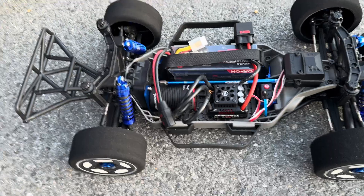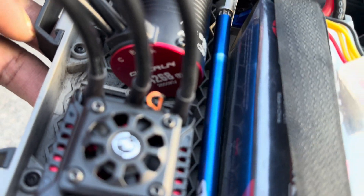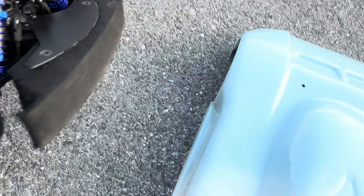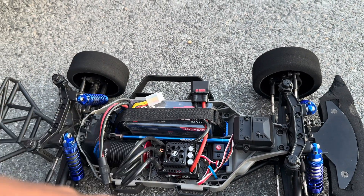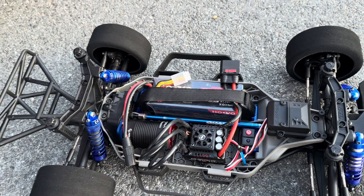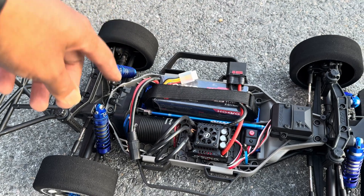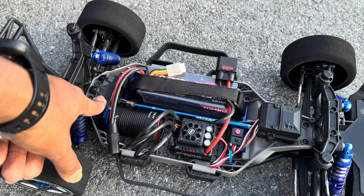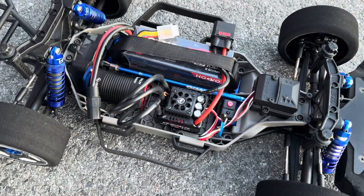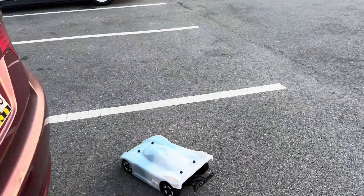All right, so here we have it — another BL150 system. This is a 4S with the 2600kV motor running with this car body, slightly different setup. I'm gonna show how I run it, put a GPS on it to see what speeds it does. It has the stock 50-tooth spur with the diff, and we're gonna run a 20-tooth pinion gear on here. Let's go ahead and run it and see how it performs.